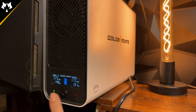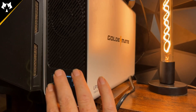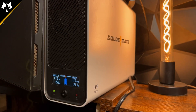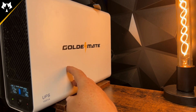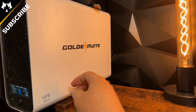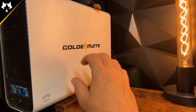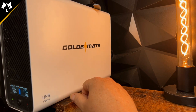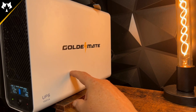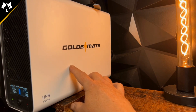To get this started, you do need to press and hold the button for two to three seconds for it to come on, boot up, and start putting power out to the inverter. If the screen goes blank after a short period, you can press the button quickly to display what's on screen. One of the other main reasons I wanted this UPS is that it's not only a UPS — it's also a surge protector. Factor in the price of a decent surge protector and you're talking at least $25 to $40 for one with eight outlets. As far as I know, this Golden Mate is the only UPS that has a lithium iron phosphate battery, which is the latest technology with a battery life of 10 to 20 years. Standard lead acid batteries in older UPS units only last two to three years before you have to replace them.